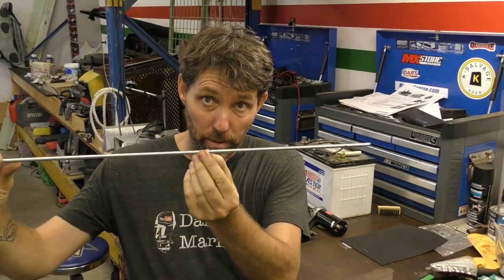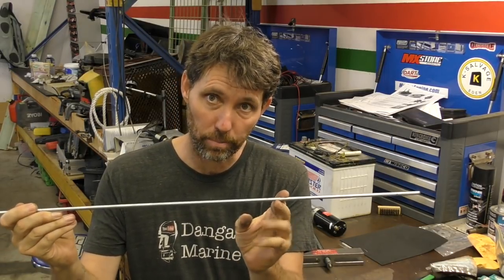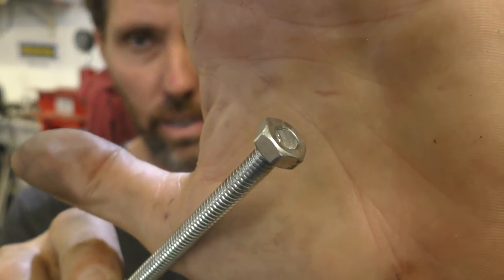I need to cut the threaded rod about here based on the length of the puller and the prop shaft. I'm going to wind the nut down to just a little bit past there, so when I cut it I can pull the nut back off and clean the thread up. I went through this in some detail on the video on the Evinrude 150, which unfortunately is a larger diameter threaded rod, so I'll make this one quickly. What I'm actually going to do is weld the nut on the end to make it into a long bolt, so I'll run it flush and weld it on there. Then we've still got the factory end to go into the bearing carrier — I'm just going to tack the nut on the end.